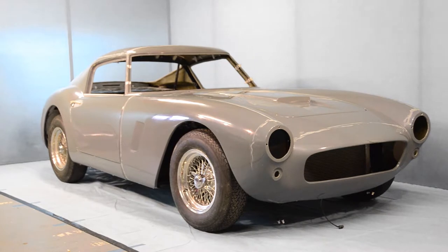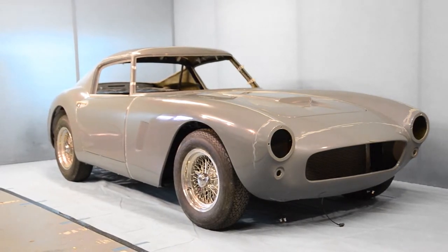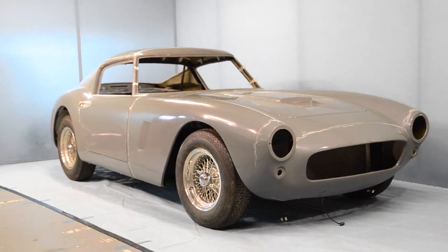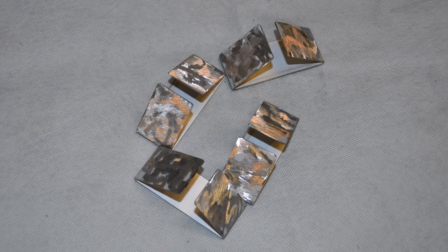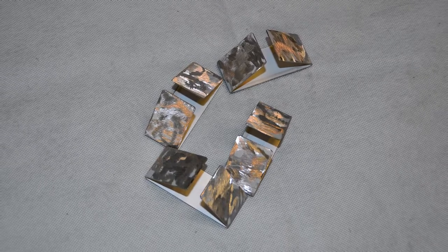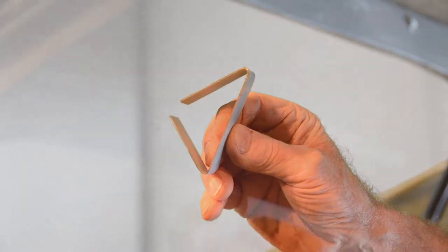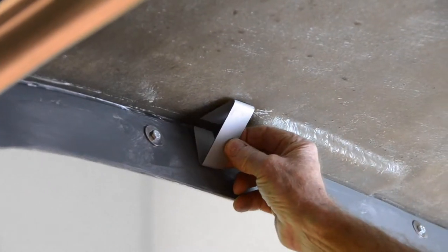With all of our Stage 3 components now fitted, we're now ready to conduct our interior prefit. We're going to start by attaching 4 brackets to the rollover bar panel. We're going to position the longer edge of each bracket facing upwards against the roof of the body.